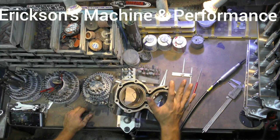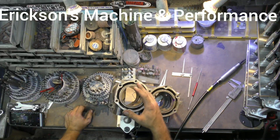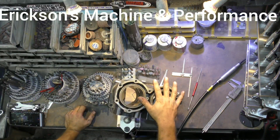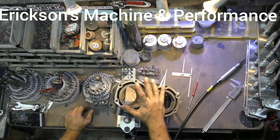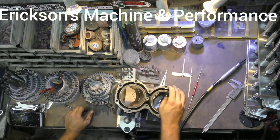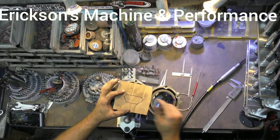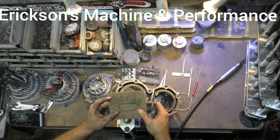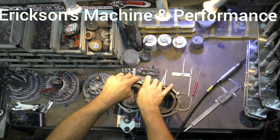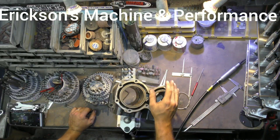Another method some builders use is taking an old piston ring, setting it in, and using a caliper to get the depth they want — then either scribing that, or some people put a drop of super glue to glue it in place so they have a solid ledge to work on. I also tell people to port the cylinder first and then have it bored and honed last, because the cutter can jump around and beat up the cylinder. It's much better to port it first, have the machine work done, and then do just a little finish porting and chamfering the ports at the very end. Another method is taking a piece of paper or cardboard, drawing the exact shape of the port you want, cutting it out with a razor blade, feeding it into the cylinder, scribing out the shape, and going from that. No wrong method — it's whatever works best for you.